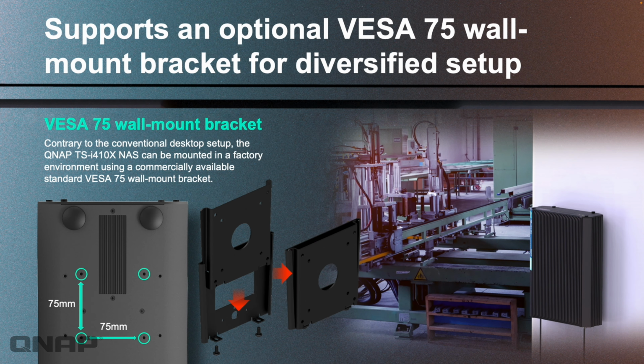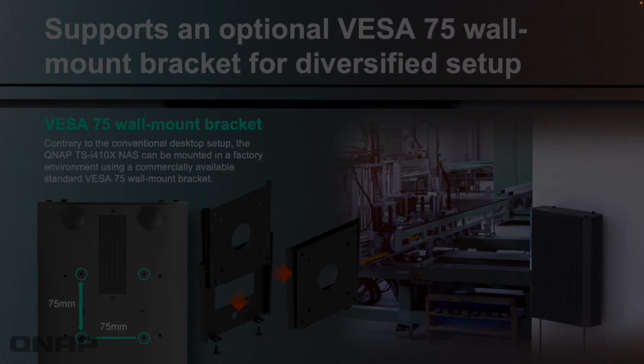There is also an optional bracket for a VESA mount, so it's the 75 mil, so 7.5 centimeters between the holes. So if you wanted to physically mount this to something, you can use that as well. Everything's all screwed in place; it's not just clipped on. You screw the bracket to the base of the NAS, and the bracket slides into the wall-mounted plate, which then attaches with some bolts as well. So it's nice and rigid in whatever application that you're attaching this to.